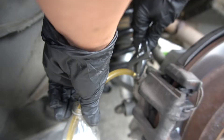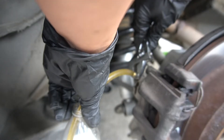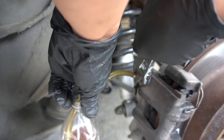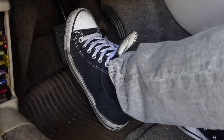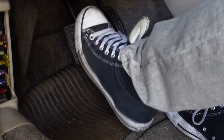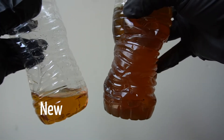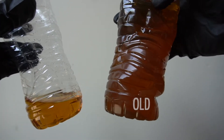The pump only bleeds out the rear calipers, not the front. You'll hear the motor making a buzzing noise. When you stop seeing bubbles and the color of the brake fluid becomes clear, you can close the valve. Have your assistant slowly release the brake pedal and turn the ignition off. If the fluid is still dark, top off the master cylinder and repeat the procedure.